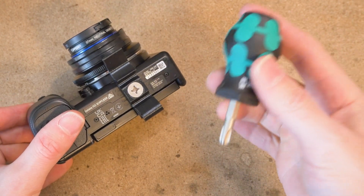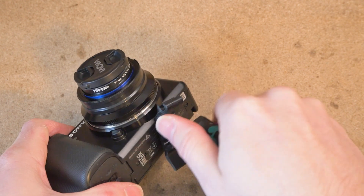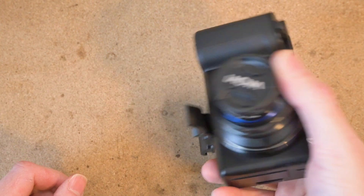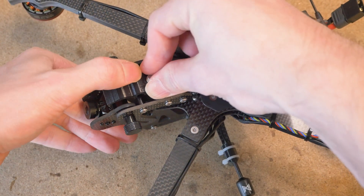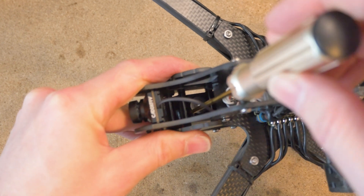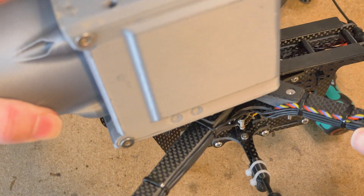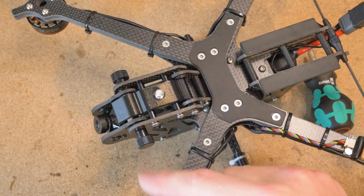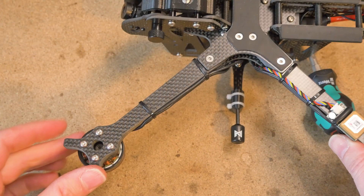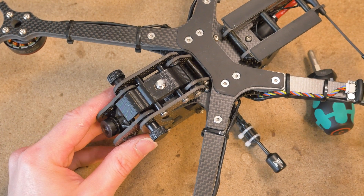As a last tip, you should pick up one of these Phillips #3 stubby drivers — they're quite handy for getting a nice solid engagement with the quarter-twenty screws for these camera clips. If you're using a Red Komodo and can't connect it using the shoehorn method, install the clip onto the mount first, then flip it over, put it on top of the Red Komodo upside down, and use a longer Phillips #3 screwdriver to screw it down from the bottom side. For very large cameras like the Red Komodo, use battery straps underneath both arms around the camera to secure it further. At that camera size you don't have to worry as much about vibration isolation — you're more concerned with keeping the camera fixed securely to the drone.